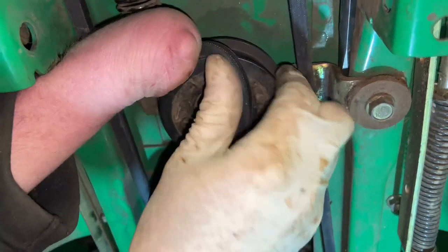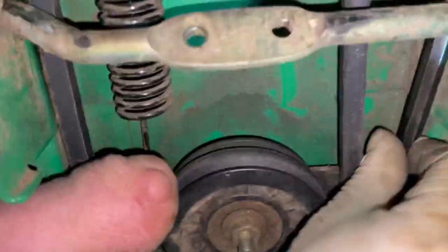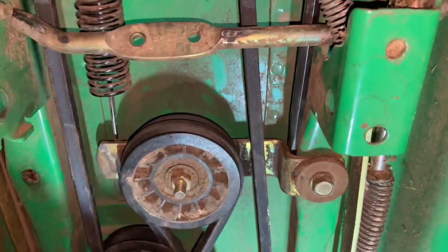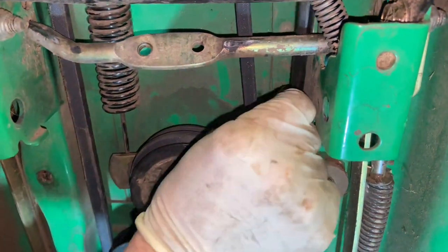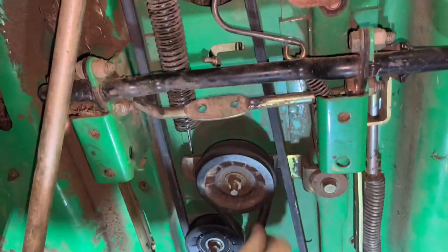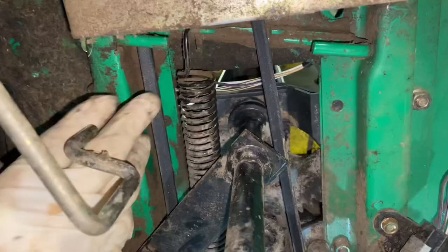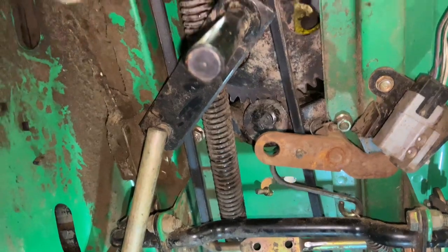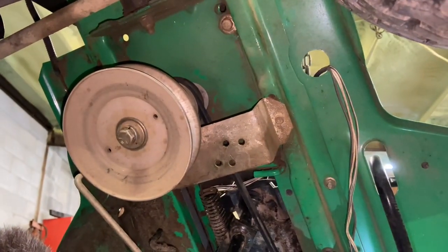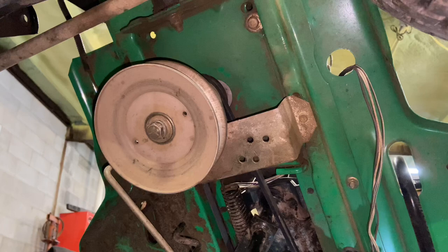Down here we may come across this a little bit tight, but you can roll it on. Being that this is a new belt it made it real loose — actually I have to pull it out and make that tension come off right there. Now this is where you really have to make sure that everything is on correctly — make sure you're around every pulley all the way, nothing is rubbing against anything. The bolt to the engine has to be tightened, that's a 5/8 socket.